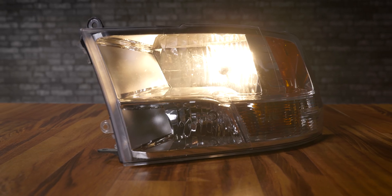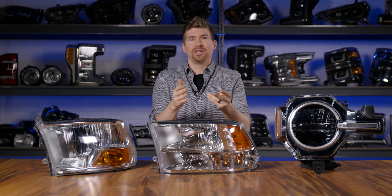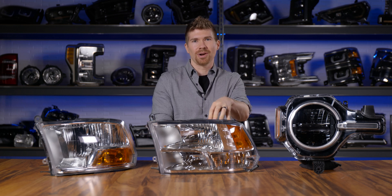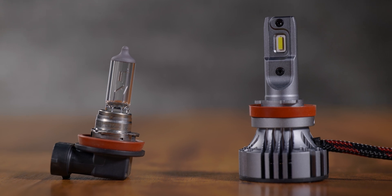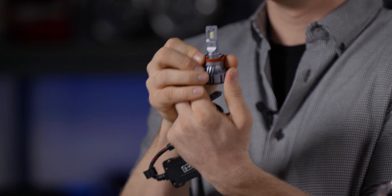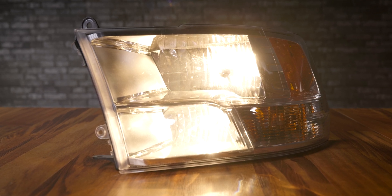What about this one? It's from the same vehicle — a 09-18 RAM — but it has a single filament bulb. This headlight has a separate low beam and a separate high beam. You have to buy a bulb that replicates this; it's an H11 bulb in the low beam and you need to get the same H11 LED bulb. As you can see, it only has one LED chip on the face of it — it is double-sided. Again, if you get a multi-sided LED bulb, these are still designed to be at a precise spot inside this reflector to give you that proper beam pattern.